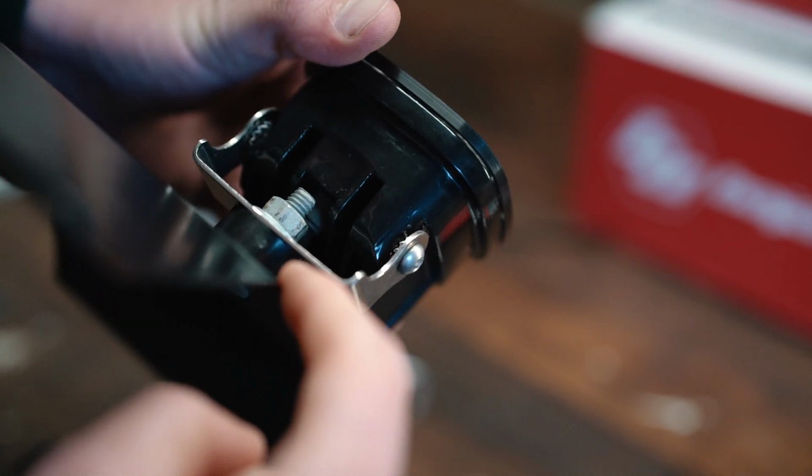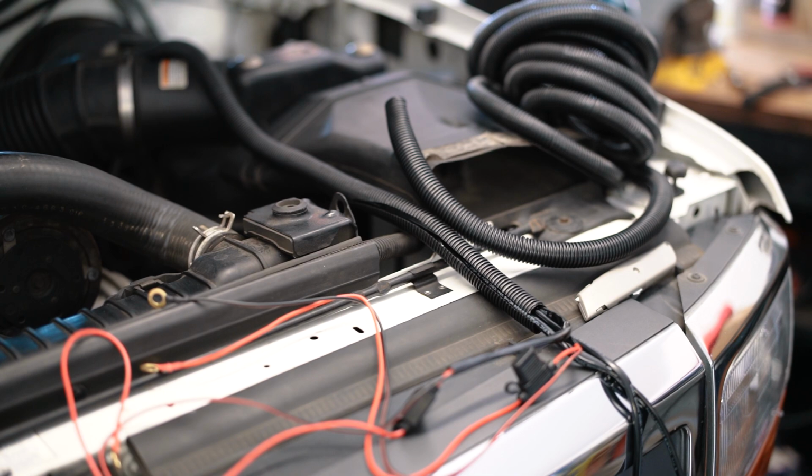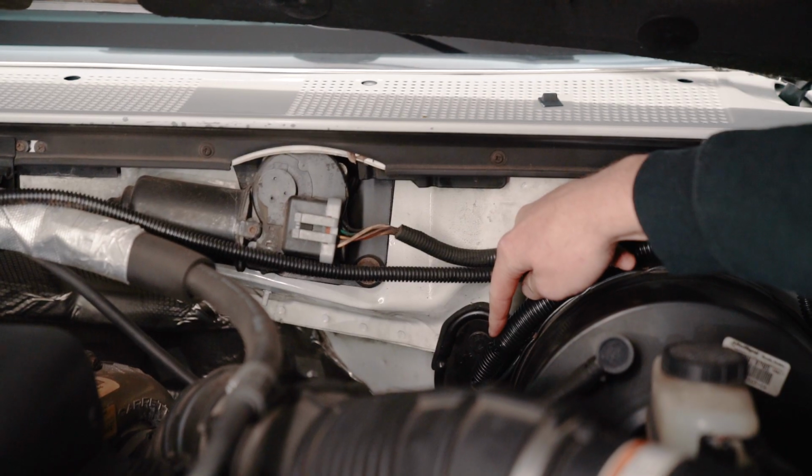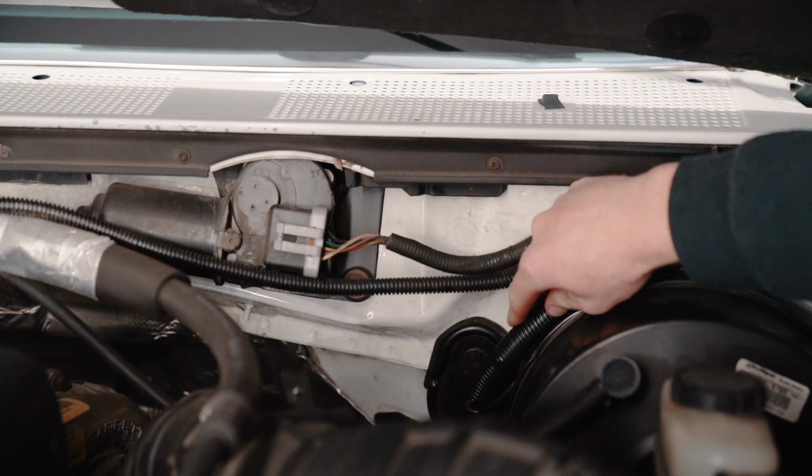To start out, the way that I like to start any wiring project, once I figured out the lights and how I was gonna get those in the brackets, is the wiring. I like to lay out everything and figure out how I'm gonna route the wires so that they're least visible, but still easy to access if I need to make any repairs or changes. In this case, I was running 2 separate harnesses and I located a hole in the firewall. I found that that's the easiest hole. That little grommet's just ready to go. You can pass everything in that way.